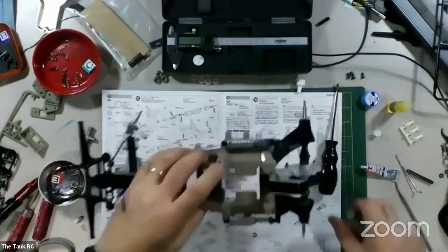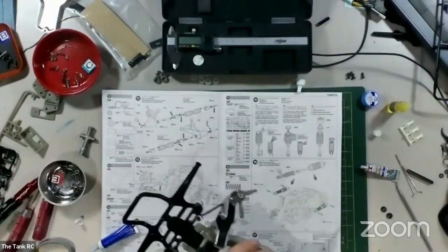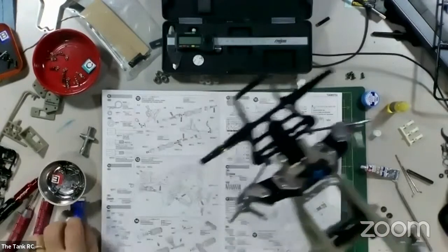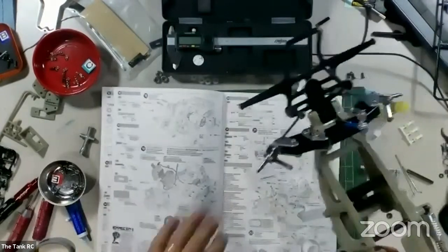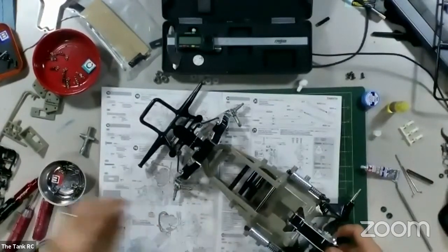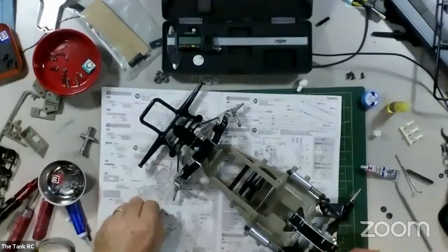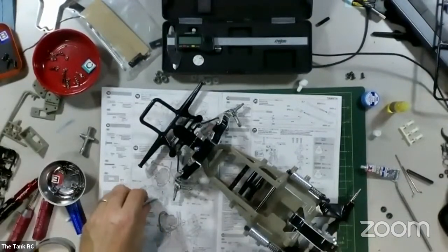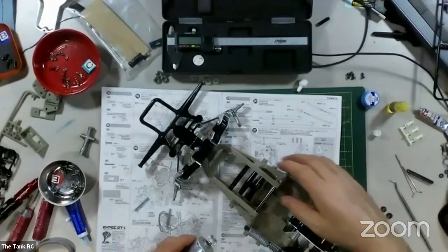Somebody was mentioning earlier, be careful using petroleum products on gaskets for shocks and stuff, that can eat the gaskets. Yeah, you got to watch you don't get a lot of it on plastic because it'll make the plastic real soft too. I try to stay away from petroleum based fluids on the shocks. Some can eat up the seals or the pistons.